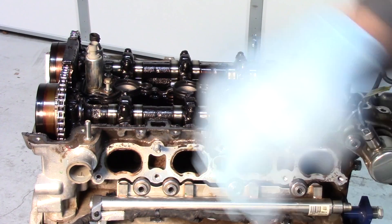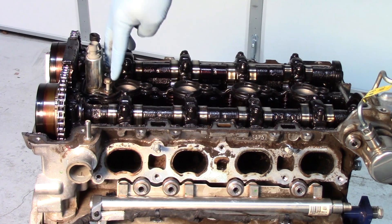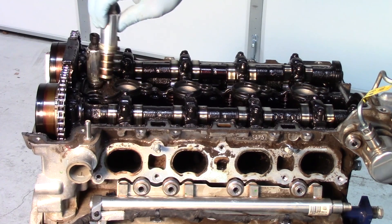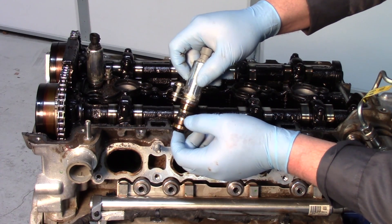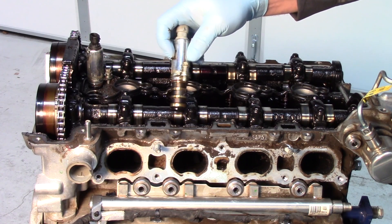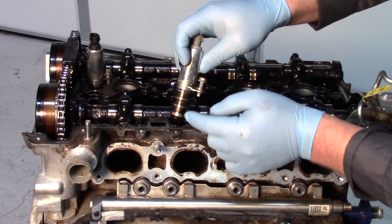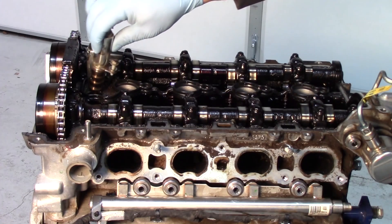The control of cam advance or retard is done through these two different solenoids. With the valve cover on there's a little opening, so the technician can unbolt two bolts and remove these solenoids. If you look at the screens in here they don't look too bad, except you'll notice some sludge. The engine oil is going to enter in, the solenoid will be cycled and allow the oil to go towards the advance or retard cavity of the passageway on the actuator.